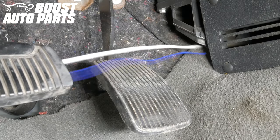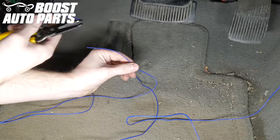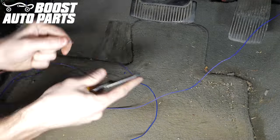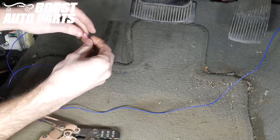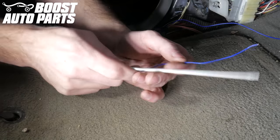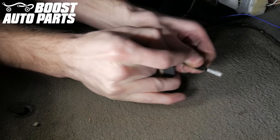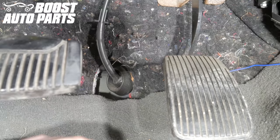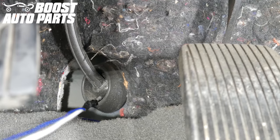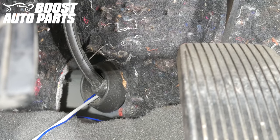On the driver's side you'll receive the wire and sturdy metal rod through the opening — just pull the slack out. You'll now have the driver's side blue wire and the passenger side blue wire under the driver's side kick panel. You'll want to splice the passenger side blue wire to the driver's side blue wire using any splicing method you'd like. Now take the loose end of the driver's side wire and tape it to a sturdy metal rod. To route this blue wire, find the grommet between the brake pedal and the gas pedal underneath the driver's side of the dash, poke it directly through the grommet, and grab it on the other side.